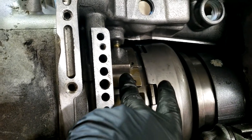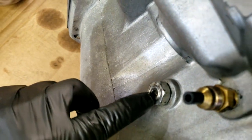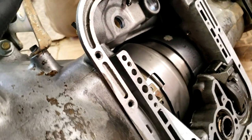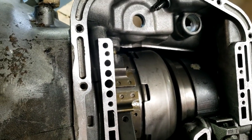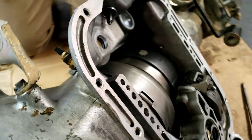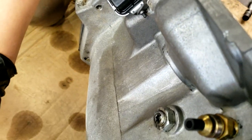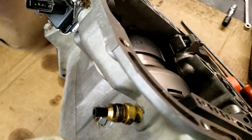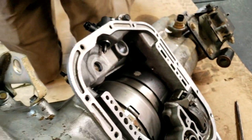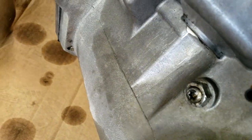And now we're going to back off the little tensioner bolt right here - we're going to back that off two turns. And that's top secret specs directly from John Cope, CRT Corporate. There you go - back it off twice. You can just use the regular ratchet. Put that on there and back it off two turns.